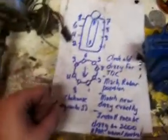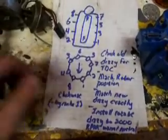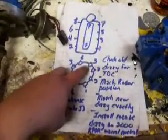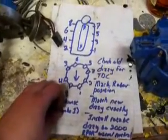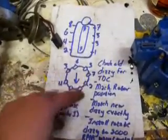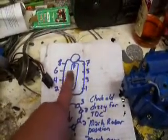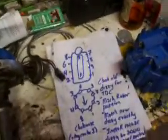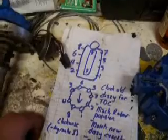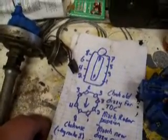I've seen people put in their cars and use special spark plug wires, braided wires or what have you, and have to run one all the way back here to make it look decent so you don't have a lot of overhang. But just remember, it has to go in this order around. And this is how your cylinders are for Chevy small blocks: 305, 327, 350. In a blue moon somewhere, you may come across a marine engine, which is actually backwards. Which is why I'm talking about it.